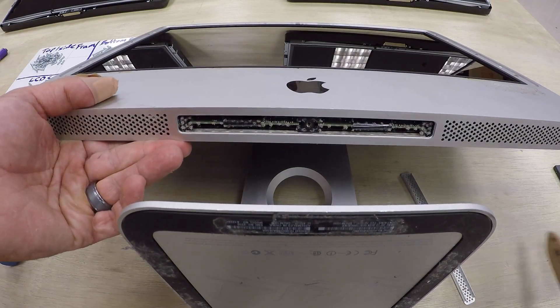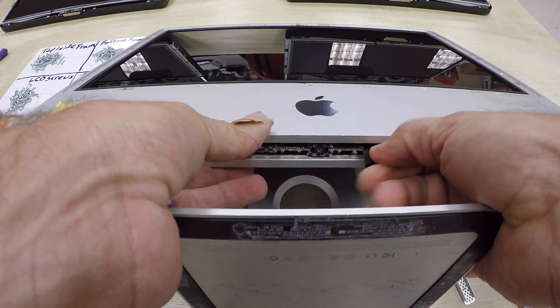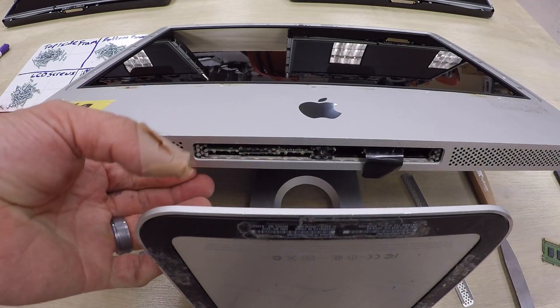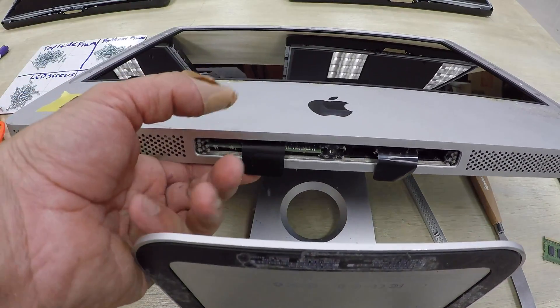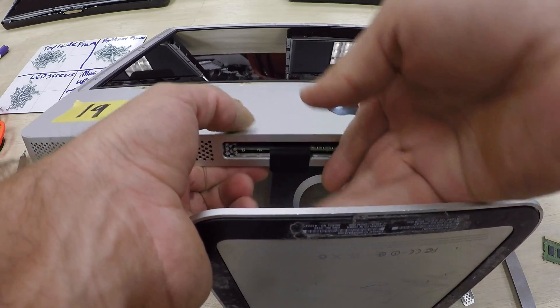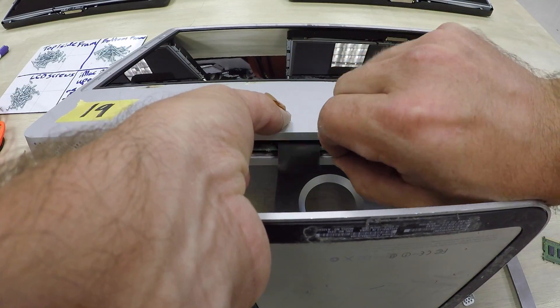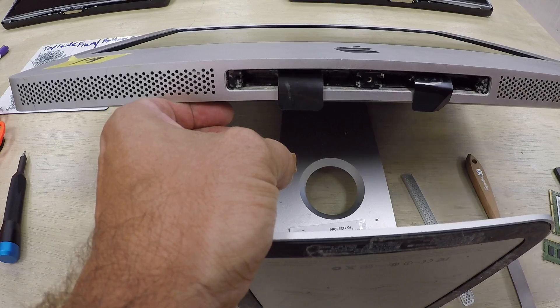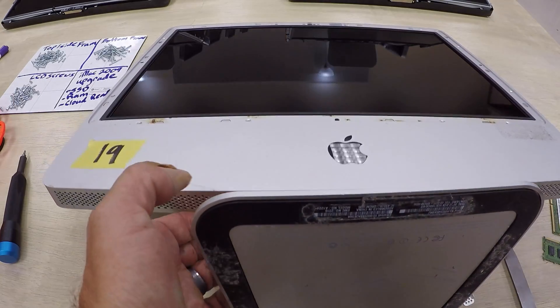You'll see it's very dirty in there. Pull the tape outward with your finger, then pull it towards you to pull out the RAM. Sometimes it's difficult — you may need to change your positioning and angle to get it out. Alternatively, you can keep watching and take the whole computer apart first, which might be a little easier.